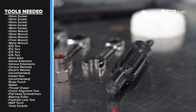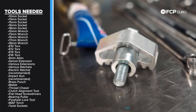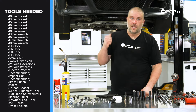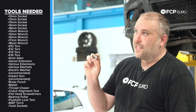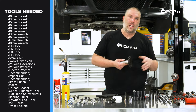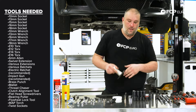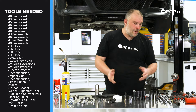Some specialty items you'll want on hand: a clutch alignment tool, pilot bearing puller, flywheel lock tool. There could be difficulty removing some of the exhaust manifold nuts, so a map gas torch is going to be extremely useful. You'll probably also need twist sockets in 13mm and 15mm range for rusted exhaust nuts. If you choose to install a new crankshaft seal into the flange rather than buying the expensive flange kit from BMW, make sure you have a rear main seal installer on hand. If it has a PTFE seal, make sure it comes with the installation tool — you will not be able to install it properly without it.